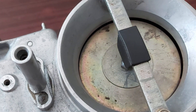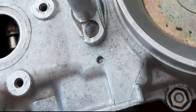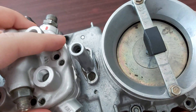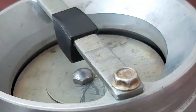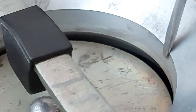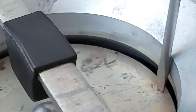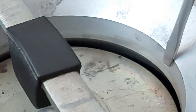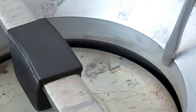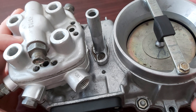This is what you get if you hammer too much — this wedge or nail, however you say it. Here is the fuel distributor. Look close at this — this is the line where the sensor plate should rest, and look how much deeper it is in comparison to its original start position as it should be. This is what happens if you hammer it.